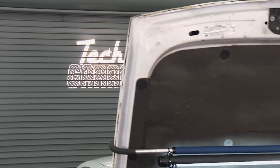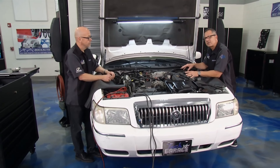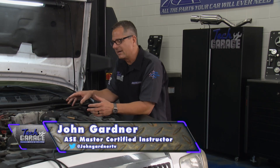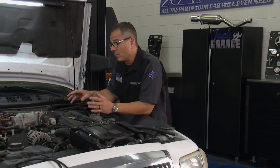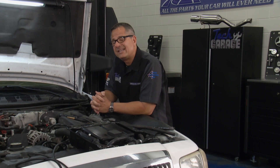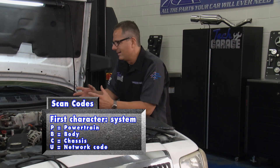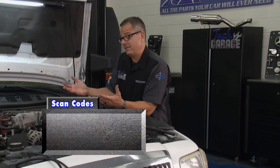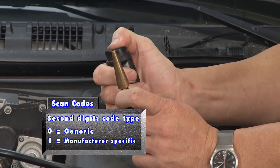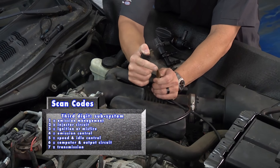Welcome back to Tech Garage presented by rockauto.com. We got project M&M back in the shop and we're addressing another code. On our prior episode we looked at that P0300 which was a misfire — we got all new coils on here with Tom from rockauto.com. The coils and spark plugs, we're in good shape. It ran real smooth, like a V8 should — lots of power, no hesitation. Now we need to address the second code: P0442 — a small evaporative emission leak. Evaporative emissions is a system that catches fuel fumes, and we're going to check it with this smoke machine right here.